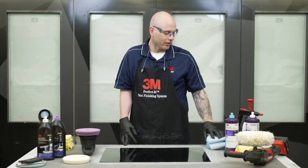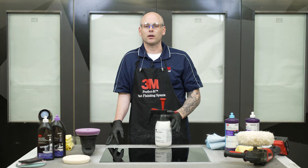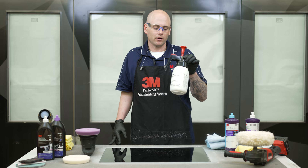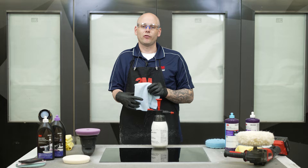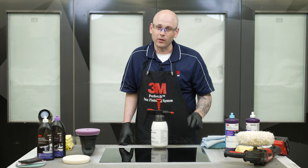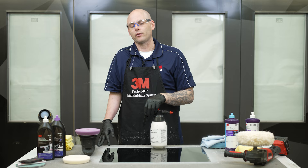The last piece of advice is to use inspection spray with a black vehicle. With white or silver, you can sometimes skip that step — if you leave one little mark, it's probably still going to be invisible. But with a black vehicle, after each step make sure you coat the panel with inspection spray and use a nice clean microfiber cloth to clean it off before moving on to the next step. If our polish is filling a little swirl mark and we move on to the final step, we might see we left one behind — and again we'd have to go through the whole process over again. So clean as much as possible between every step.